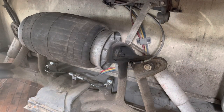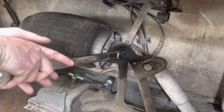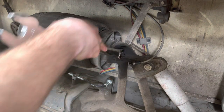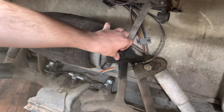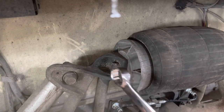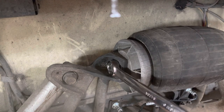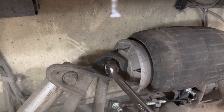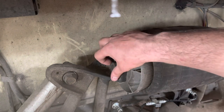The airbag itself is only held on with two nuts and the size of them is an inch and an eighth. What I like to use is a box end wrench and then just crack them loose. They're not that tight — you can probably do it by hand. I like to use a box end wrench because it's kind of a tight fit inside of this bogey arm pocket, but just loosen it up and then you can spin it off.